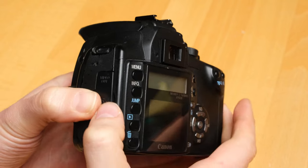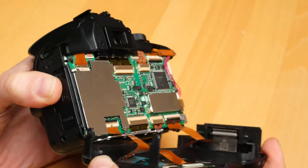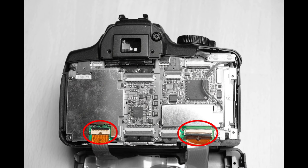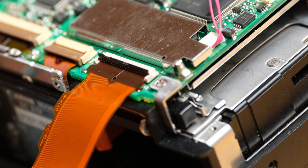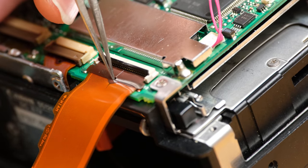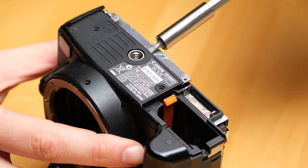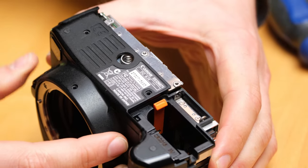Now you can remove the back cover — we don't have to use much force, it comes off quite easily with a bit of wiggling. Once we've opened it up, we have access to the circuit board — well, to the first circuit board. Let's remove the two cables that connect it to the back of the camera by using your tweezers and lifting up the dark part of the connector. Now we can remove the front cover — all we have to do is slide a screwdriver in underneath this part and lift up. The front cover then comes off easily.